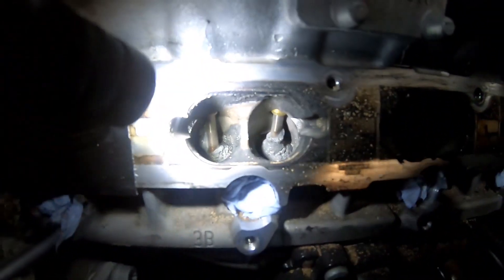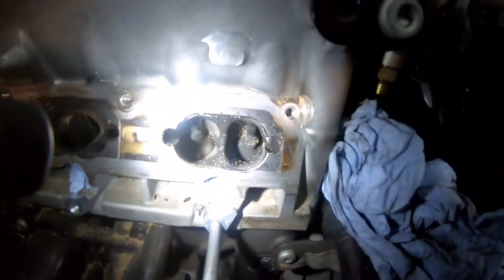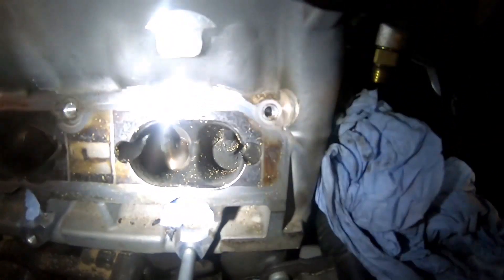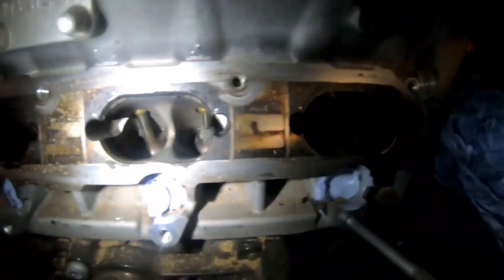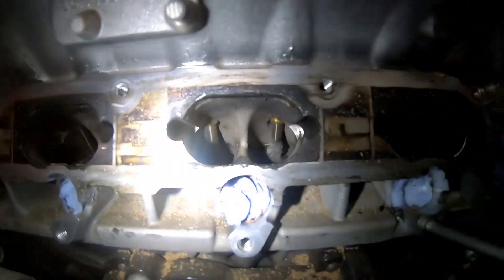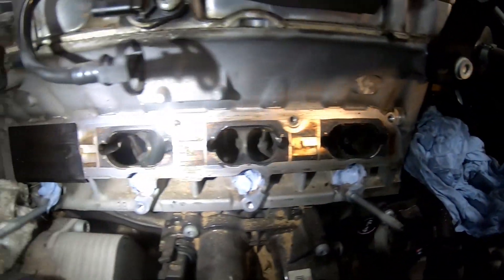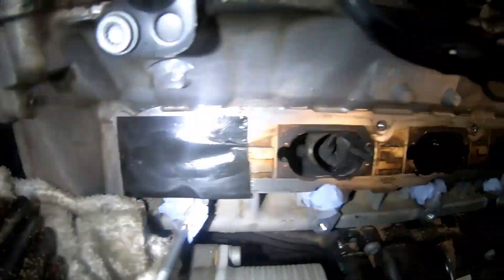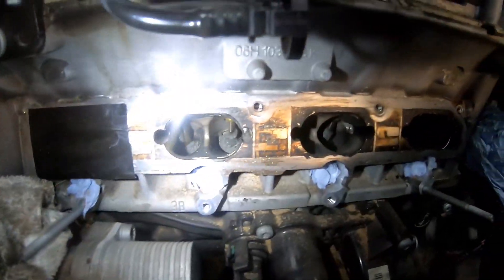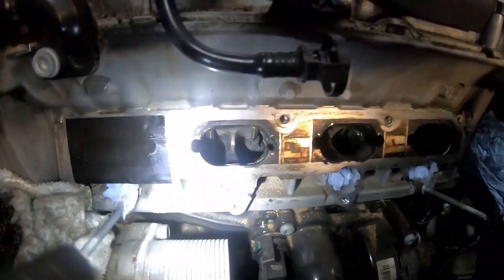Our first blast of the ports and it's starting to break the carbon down. It is pretty heavy - this one's probably done the best. That left valve looks pretty good. It's quite hard built-on stuff so we'll just keep blasting and it will eventually come off. That's probably only 5 minutes of blasting and you can see the results pretty quickly - it's already starting to clean the throats up. Once these three are done we'll move to that final cylinder. We'll pull the tape off and get a before-and-after comparison next to each other.